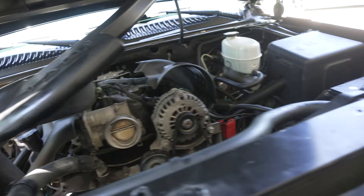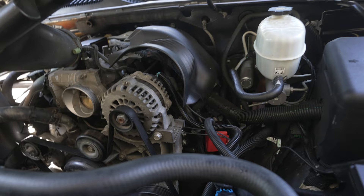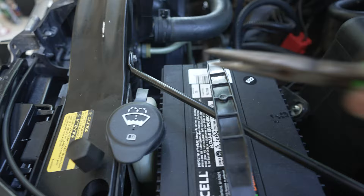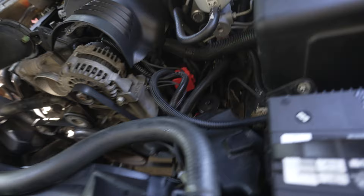I went ahead and repinned because the guy that's tuning is going to use OBD2 instead of pulling the PCM out to a bench. When you're pinning those wires, put a little bit of grease on them — it'll help that metal go through, and it goes way down farther than you think. You can literally watch it go through. What I did was take a pair of needle nose pliers and used them to push it in — I got more even pressure that way and was able to get it in.